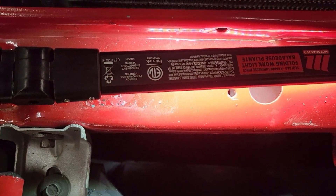We'll definitely gain a half inch just from that. I wanted to get OEM cooling fans — I think there's a chance the motors will be beefier from an older contour, mystique, or late 90s cougar, which had the same twin fan setup. I saw a YouTube video where a gentleman compared OEM fans to brand new aftermarket replacements and there was a big difference in airflow. Cross my fingers the fans will be in good shape — they're supposed to pull close to 4,000 CFM, which is probably about 2,800 more CFM than what we have right now.